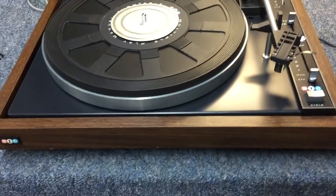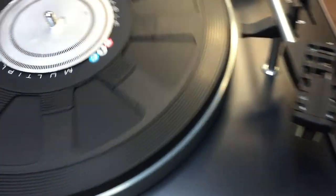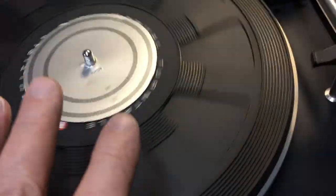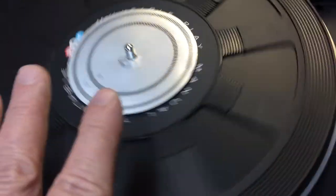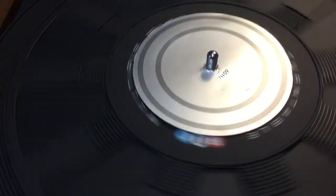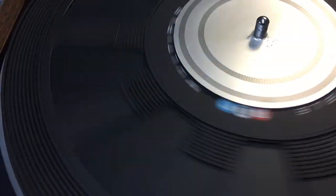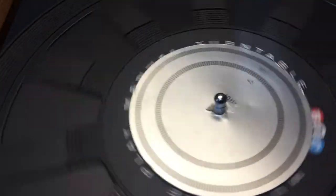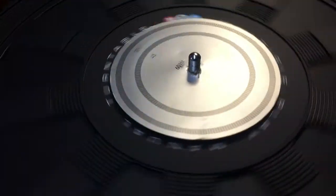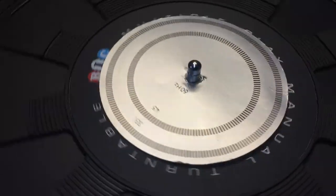It's been just your routine maintenance items after 35-plus years. Let me go ahead and get things back together and we'll start doing a little testing with it. Now having the new belt installed, using our little strobe scope — the camera won't pick this up, but I am blown away by the accuracy of this motor and this turntable. It is absolutely spot on. There is no deviation to the plus and no deviation to the minus. It is locked dead on at 33 and a third. This is absolutely perfect. And when you kick it up to 45, it's the same situation — right on the money. Very little deviation if any on 45, and none on 33. I'm extremely pleased with the speed accuracy of this.